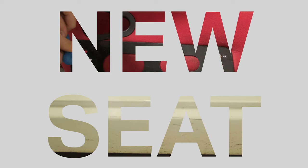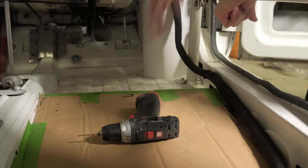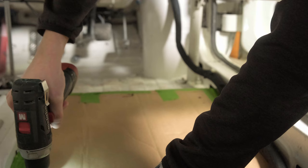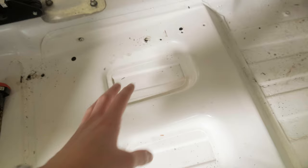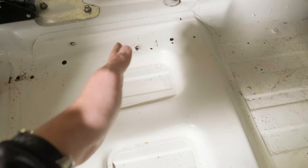Changing the seat is when the car truly felt like it became mine. I removed the old OMP seat and fitted my very snug Cobra seat, which I would recommend to anyone who's very slim. I used a cardboard template to mark out the drill pattern and drilled to a standard M8 fitting — the standard for all race seats. Now I need to drill my six-point harness holes, checking the angle because the crotch strap should be either 20 degrees behind or forward from vertical as specified in MSA regulations. I believe 20 degrees backwards is slightly more optimal.